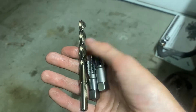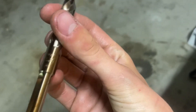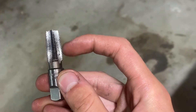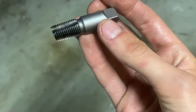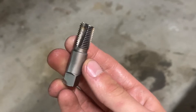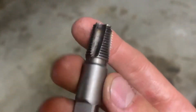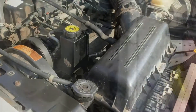Here are the tools I used to drill and tap the box. First is a 29/64ths drill bit — you want to use a 29/64ths versus a 7/16ths so you can get a little further down on these taps. When you're going through that really thick steel it's kind of hard with the 7/16ths to get to the bottom. You need to do that so your fitting goes in deep enough. On the bottom hole, once you break through the steel there's only about a half inch until you hit the other side, so that's why you have to cut down a tap. I cut one of the taps down and it did the job correctly and worked out great.